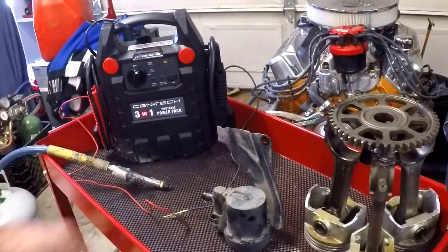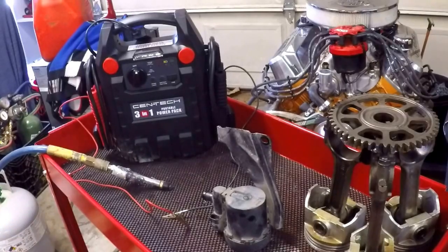I don't have a smoke tester to test the whole system, which I would certainly use if I had one — it would immediately tell me where the problem is. But there's a quick way to check the purge valve without even taking it off the car, so we'll check the purge valve next and see if that's the issue.